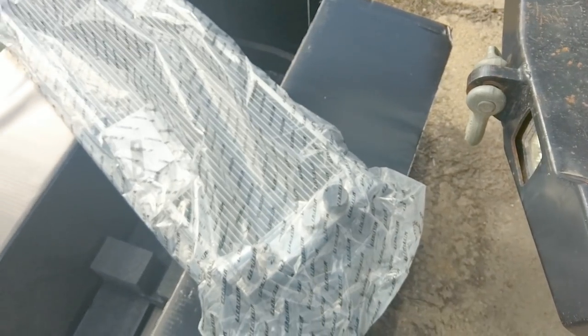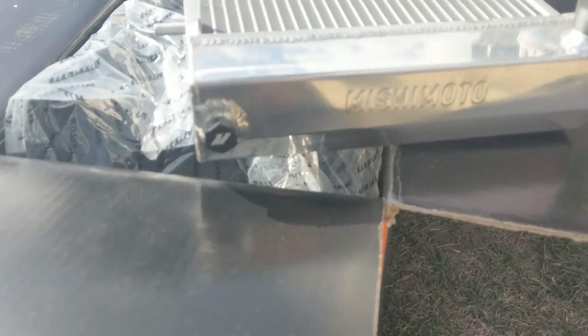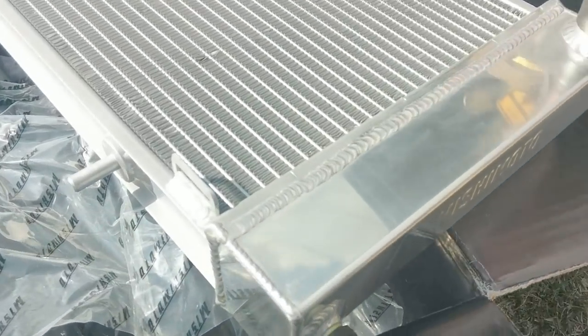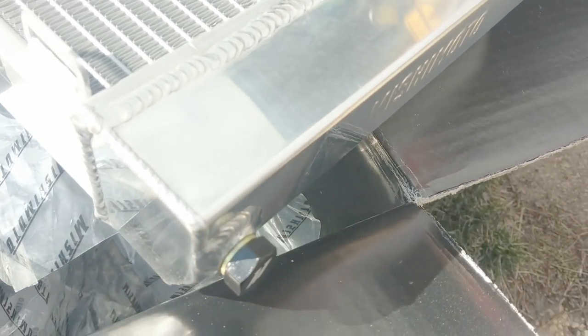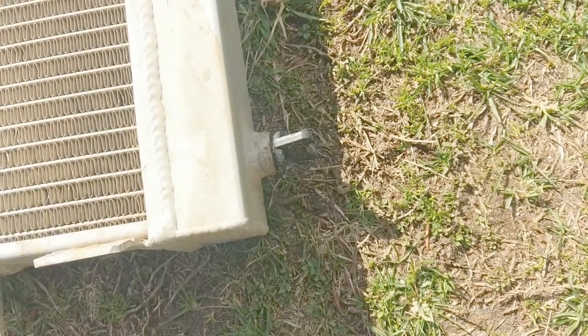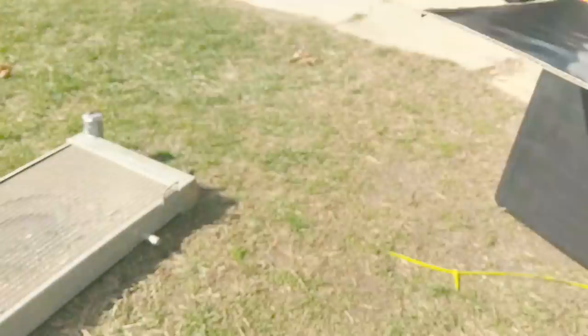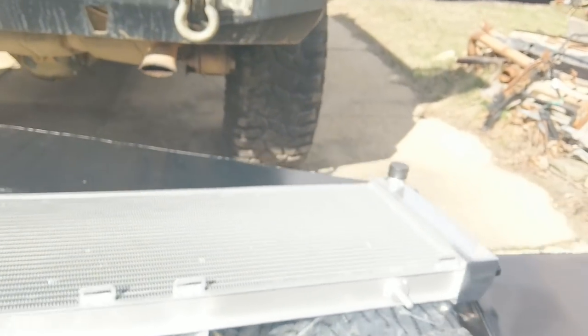Well, it looks nice, but I'm not sure what I'm going to do about that trans-cooler part. Luckily I have an external, so if I really needed to I could just go through that, but then it doesn't warm up in the winter. Very shiny indeed. So down here we have our drain petcock, and it actually looks like solid metal with a nice spacer in there — no rubber business to go bad, because on my old one the rubber seal was cracked and I had to replace that. It looks thicker — actually the side tanks are thicker anyway.